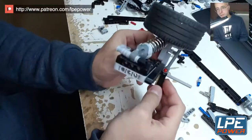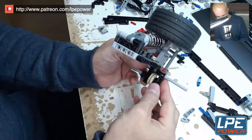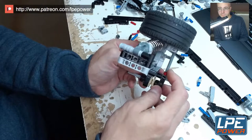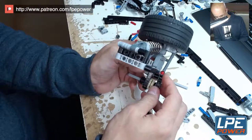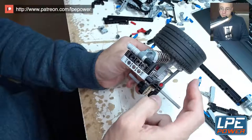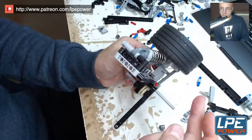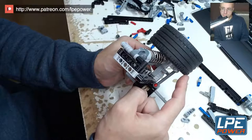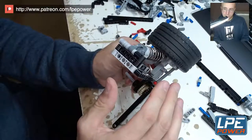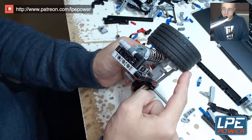Since this way, of course, we have toe in, we are gonna move this accordingly out by one stud so that this is gonna be parallel. But not quite. We're gonna move it out by half a stud, so we do have slight toe in, because we do want a very slight toe in, because when the car is driving along, the wheels are going to naturally be pushed out, and since we have the Ackermann geometry, we are going to have Ackermann steering regardless of the fact that the wheels are at a slight toe in. So,